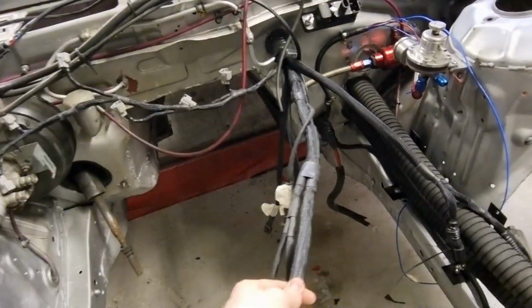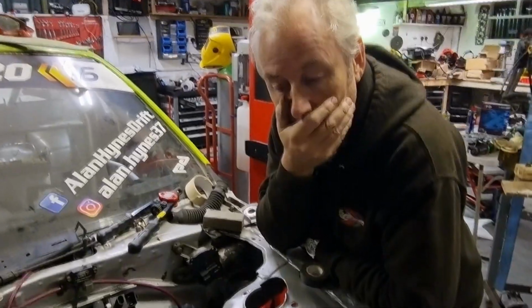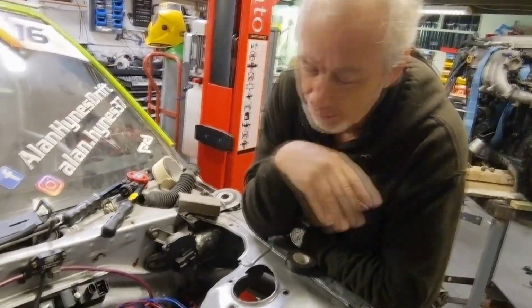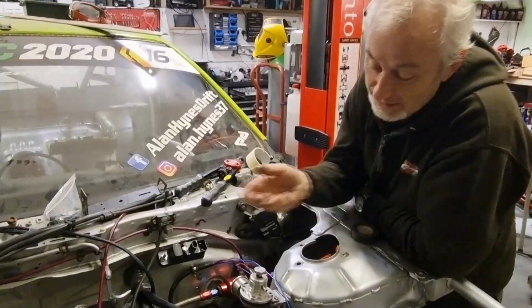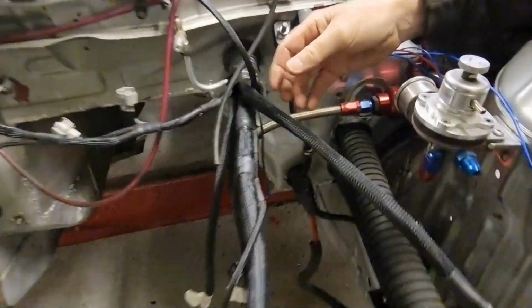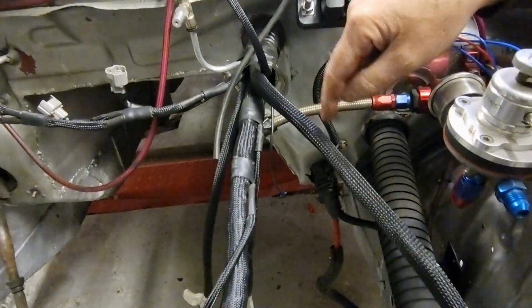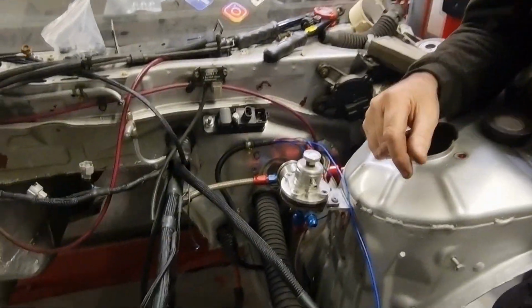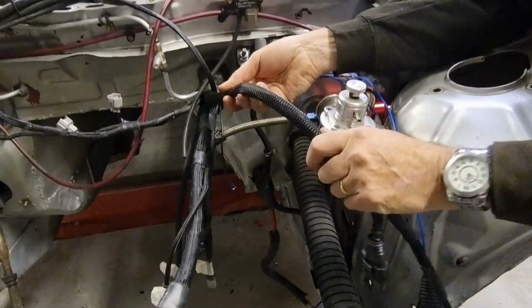So what's unique is that it's all twisted, right? It's kind of like pretty high tier race car stuff. It's concentrically wound. Basically, you have layers of cables inside, and you'll start off with maybe a heavy cable in the center. You wind it, then you wind the next layer outside the opposite way. What it does is it makes it very, very flexible.